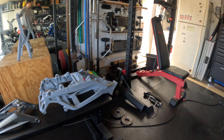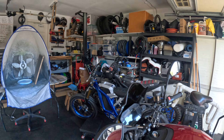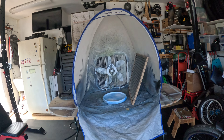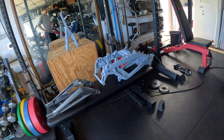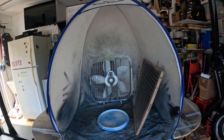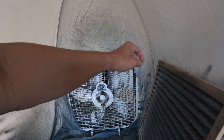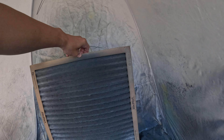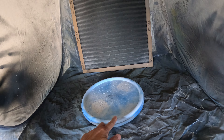Here it is — that's the frame. The swing arm that came off of this bike, now that I have the Kale swing arm on there, so this is the stock swing arm. I bought that subframe, and what I've done so far is sanded down all of these parts. I went from 60 grit to knock off all the hard edges, and all the way to 400 grit sandpaper, all by hand. Now it's nice and smooth — buttery smooth. I primed all of these three pieces.